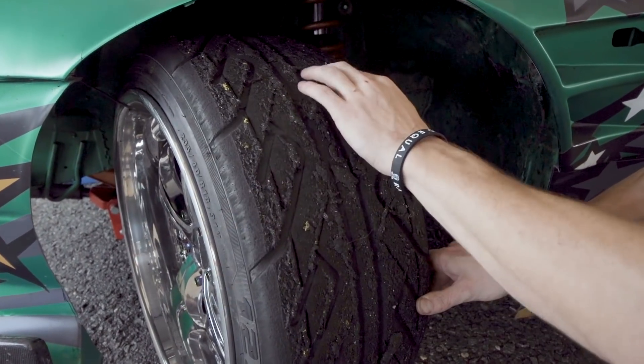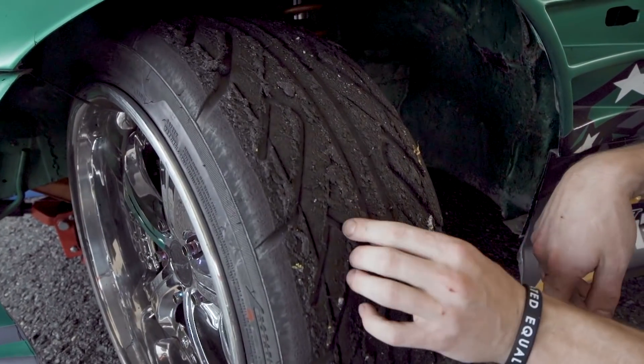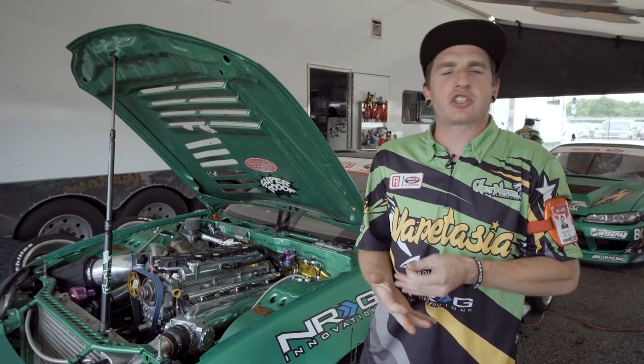The tires we're using are special racing compound tires. They're very sticky and they deal with heat a lot differently than a common street radial. These tires have a lot of gum on them — you can literally peel the rubber right off. They're extremely soft. When you start heat cycling a soft compound tire too much, it hardens. So keeping the tires soft is essential to keeping grip good. More grip means more heat, and too much heat means less grip. There's a threshold to maintaining the tire to keep it where we need it to be successful.